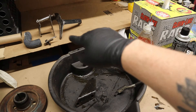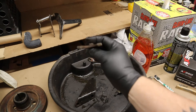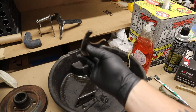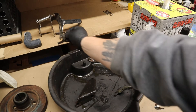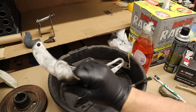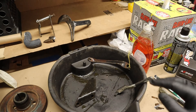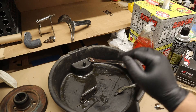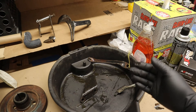Up here I've got a couple of pieces I've already done. Here's the hold-down for the distributor — this thing was pretty well covered. I just let it sit in dish soap for a couple of hours while I did other things, came back, brushed it off, then hit it with the die grinder with a red Scotch-Brite disc, and that got it pretty much to where it is right now — ready for a quick coat of paint. A couple of other brackets, the alternator bracket here needs some more sanding to get the rest of the old paint off, but the rest of it's pretty well cleaned. There's a little bit of surface rust, but that'll get hit with the surface prep disc and get ready for paint. I've got a couple other brackets that have just been sitting in the soap while I've been doing other things, and I'm going to wipe them down. I use the brake cleaner to rinse them off, then hit it with the die grinder, and that'll get those pieces ready for paint.